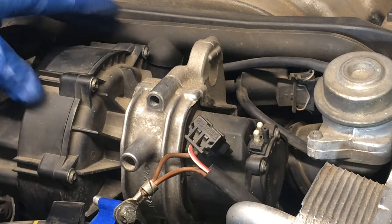This is what I've got — pulled it out of a bag I had on hand which says Mercedes and has a Mercedes part number on it, probably an aftermarket version. I can't remember where I got it — probably FCP Euro or AutohausAZ. I'll try to put that part number up. What we can do is use the old hose to figure out the length, then give yourself a little extra. To get a clean cut if you don't have hose cutters, use a razor blade — don't just push down and smush it; you want a slicing action — and that'll give you a nice clean cut.